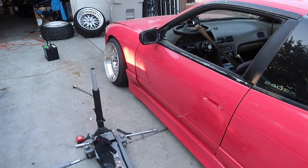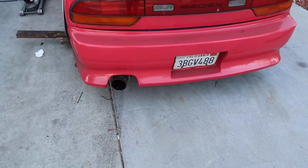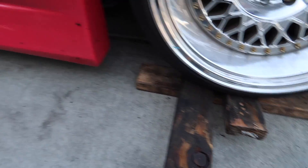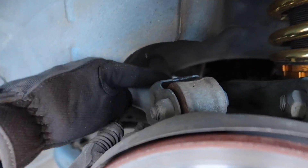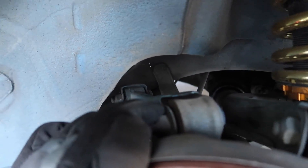Since we're on a slope, I tried to jack the rears with the diff and it slid down. So I'm doing one side at a time — I think three blocks here is gonna do the trick. Now I'm just gonna take out the toe arms and the traction rod, should be fairly easy, 17 or 19 — I don't know — but pretty plug-and-play. Let's get to work.